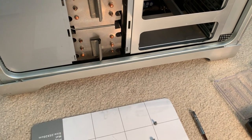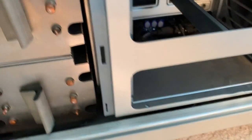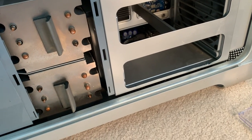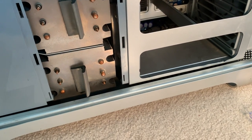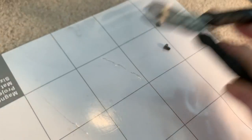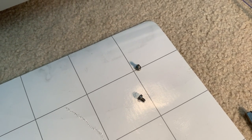This project is going to take at least a couple of days. About six hours after I did the introduction, I found that much like on the 2006, the screws that went in here did not want to move. I dinged that up a little bit — no big deal. However, unlike the 2006, bathing it for about six hours in liquid wrench and renewing the application got them to go. Fortunately, I've got a short screwdriver that enabled me to get in there, and with patience and consistent liquid wrench application, we ended up getting it off.